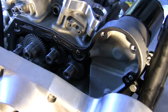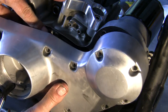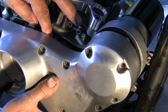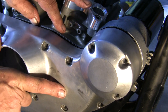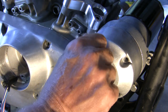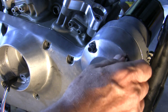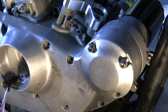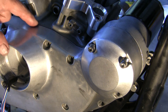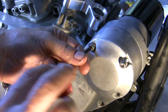I grease those races again. Then what I do is look for the pinion shaft race, line it up so it's about even, and you can feel it went on. Push it forward. I put a bolt or two in there, and I see that the gasket is in there fine. I'm just going to snug a few of these Allen bolts up.